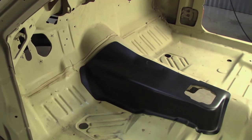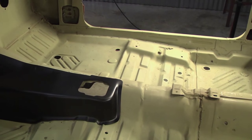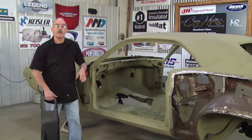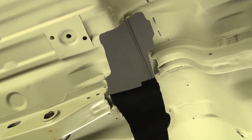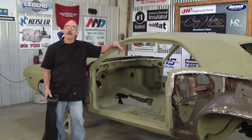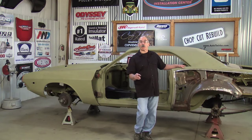When we look at the floor of this car, you're probably thinking it doesn't look that bad and could just use a patch underneath the passenger seat. That would be true if it weren't for the fact that someone has decided to re-engineer the car and cut the torsion bar crossmember in half. That would be like having a bridge and knocking the supports out — that's not going to work. So to get the torsion bar crossmember back in the car, we're going to have to cut the floor anyway.